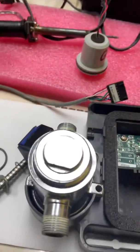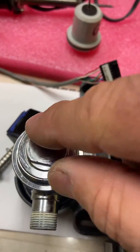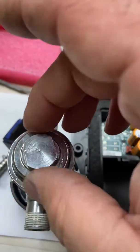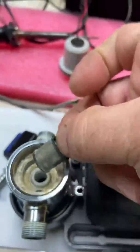If it still doesn't work, it could be a water flow problem. This is the valve. Shut off the water, then unscrew this piece, and inside here you have a strainer. Sometimes the strainer gets clogged up — you can try cleaning that.